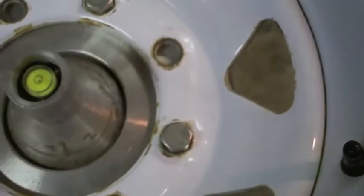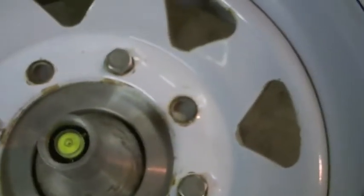That third tire: one and a half ounces came off and looks like about one and a quarter ounces going back on, so it's pretty consistent with what it was before. This one has a patch in it — that's the first Tread Right tire I've seen that used a carcass that needed a patch. It's not a problem in my mind; it's fine, because obviously they put a brand new rubber tread over it, it's a sealed patch, and it's fine. I just wish it wasn't there.